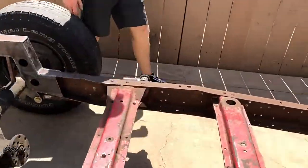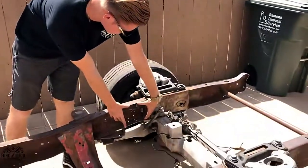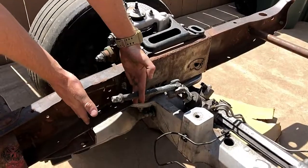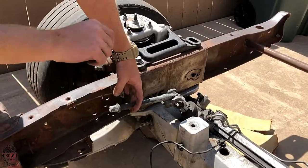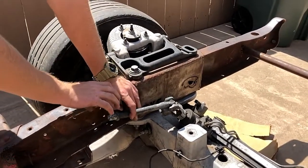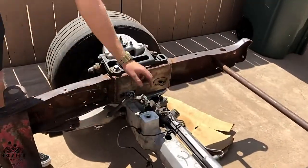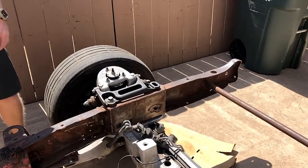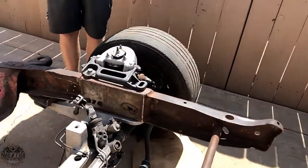And then it's getting electric power steering. There's a company called E-Power Steering that makes an electric unit that I will pretty much weld into the frame right here, and the steering rod right here will go to it. It's got a motor with a gear, and then it goes up to your steering column, and it's electrically controlled, so when it turns, the motor assists. So you still feel the road. Literally all you have to do is top off the steering rack and put the lines back into itself. You can be sitting in a parking spot with 10-inch wide rims in the front and just spin it with your pinky, or you can go full manual and it'll be like an old truck again. So that's cool. It's super sick.